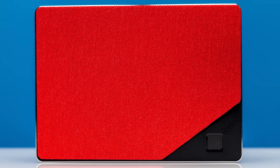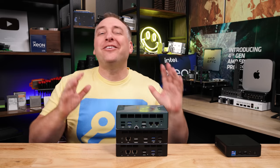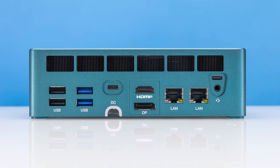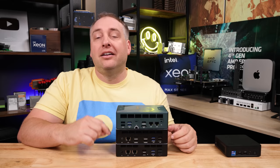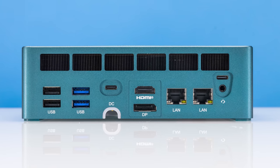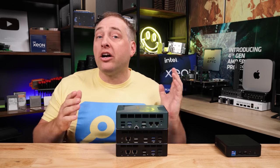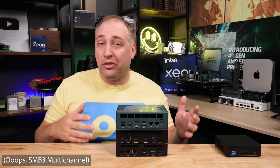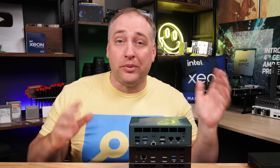Looking at the top, you can see design evolution across generations — the GTR5 had massive light-up AMD branding, the GTR6 had a replaceable top panel, and the GTR7 just looks really cool. The back is where things get wild: it's a mashup of GTR5 and GTR6 features — HDMI and DisplayPort, two USB 2 and two USB 3 ports, and two Intel I225-V 2.5-gigabit ethernet ports giving you five gigabits per second of total networking. Combined with SMB Direct and SMB3 multi-channel, you get full storage performance using just an unmanaged switch.